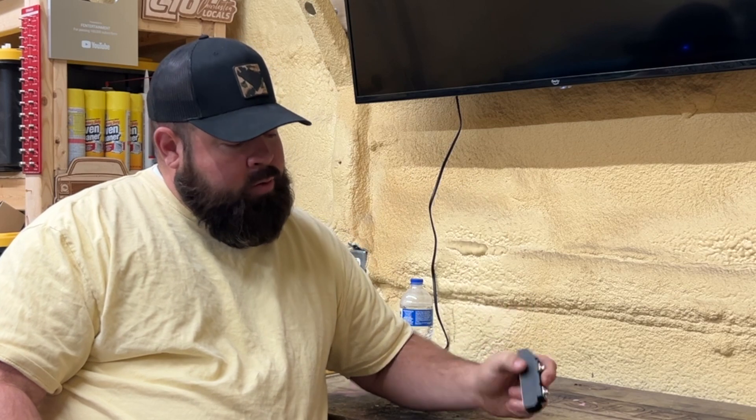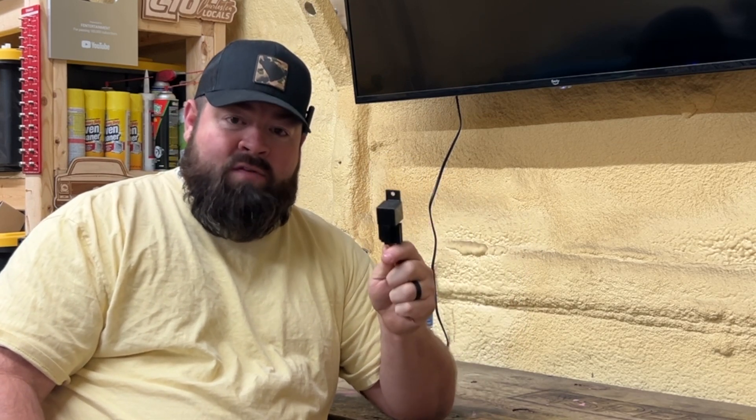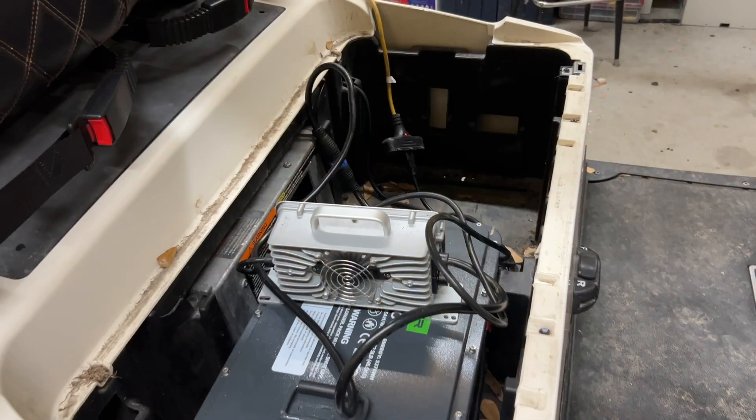Today we're going to remedy that problem with a diode — this diode has terminals on the very top, and I'll place a link in the description. You can get everything you need to add this safety switch back to your lithium battery conversion for about 30 bucks. All the links will be in the description below. You'll need a diode and a relay — I just made a video about relays. This is a 48-volt relay, but if you have a 36-volt golf cart you need a 36-volt relay, and a 72-volt cart needs a 72-volt relay. I'll show you exactly how to install all this so the cart will not jolt forward while charging.